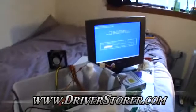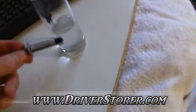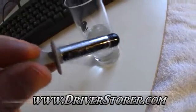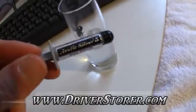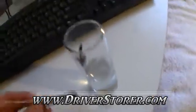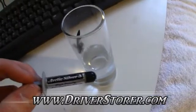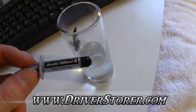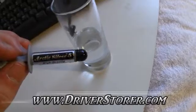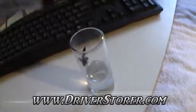While we've got Windows installing we're going to do a little test to see if we contaminated the oil with a little bit of Arctic Silver paste — which is the CPU heat sink paste. We're going to see if it will make the oil conductive. That would be an important thing to find out before we take a high-powered computer and just stick it in, heat sink and all, and the Arctic Silver slowly comes out. So we'll drop a bit in and mix it up and test it with the multimeter.